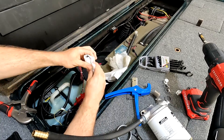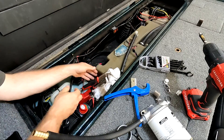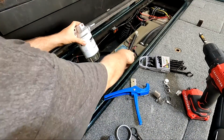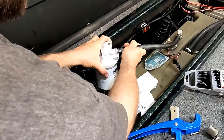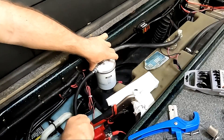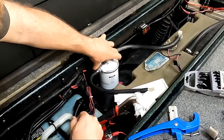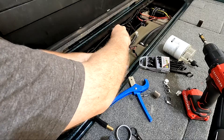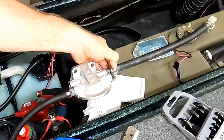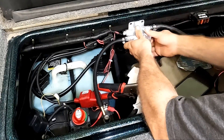Just to make sure we don't have any fuel spillage, I'll go ahead and clamp this down. Now with the fuel line cut, let's fit it onto the fuel filter and see where we're going to be able to mount it. It seems like right here is going to be a pretty good spot, and then we can loop back around and connect it over here. For hose clamps, you want to tighten them down just enough so you see the edge start to bulge — then you know you've got a good connection.